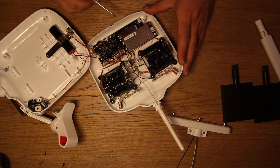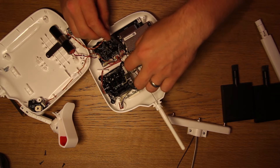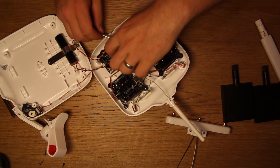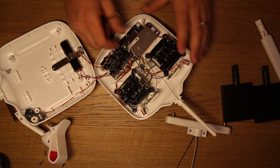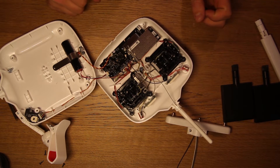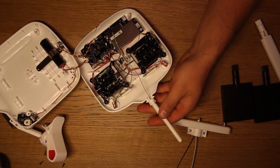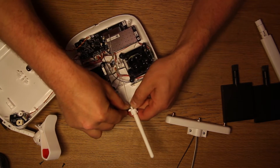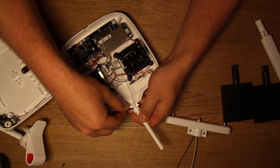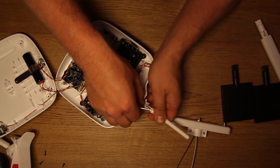Normally they've got some kind of silicone over them so they don't get loose. I've already removed that silicone — just be cautious when taking them off not to damage any cables. I'll just unplug all those cables. As you can see they are different lengths, so you can't really get them wrong when you put them back in. Take the antenna off here, clip that together and pull it out forward — it should just come out. There we are.